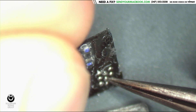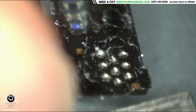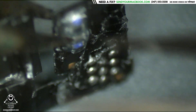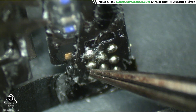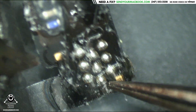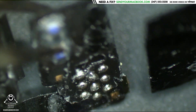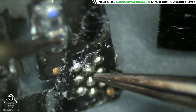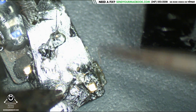There's actually a bunch of glue under there. I'm just going to try to turn up my HDR and my exposure so that you can see what I'm getting at. This is going to be difficult to show even under the microscope because of lighting, colors, and all that. But if you take a look, there is what appears to be a layer of glue or rosin over the actual solder. This shows that when this was delivered, it was impossible for this ambient light sensor to have been soldered to the flex because there's this layer over it. There is a clear layer of crap and junk over here.